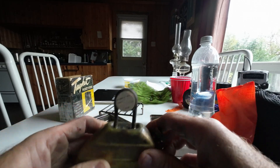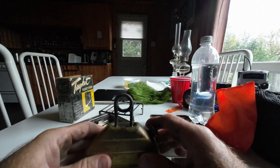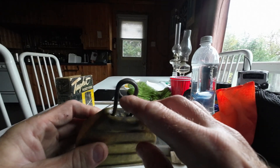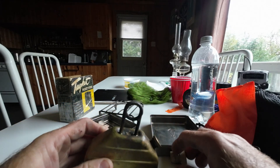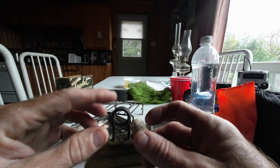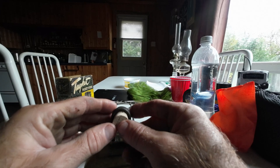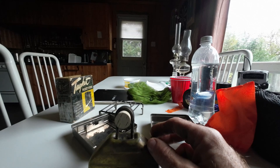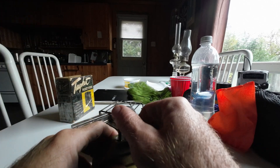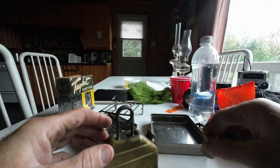You want to make sure the cap is tight. Pop that cork out — this is your burner right here. There's a tiny pinhole right there; that's what you use that wire for, to pierce that hole. Originally these came with a metal insert with a rubber ring on the outside, but chances are if you have one it's going to be cracked and dried out. So I found that a number three cork works really well.